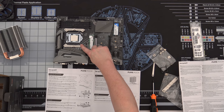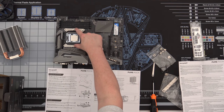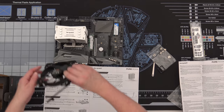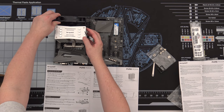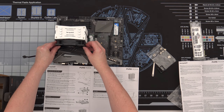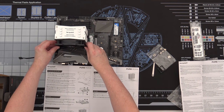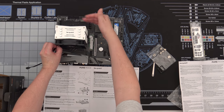One more step toward having the cooler installed. These are the two post mounting brackets — the posts are underneath, and the cooler will mount to these two screws. Every cooler is different and sometimes an adventure. Their suggestion is to mount the cooler sucking air into the fins, but that potentially blocks the RAM slots. I'm actually going to put the fan on the other side in a pull configuration to suck air through toward the back of the case, leaving plenty of room for the RAM slots.